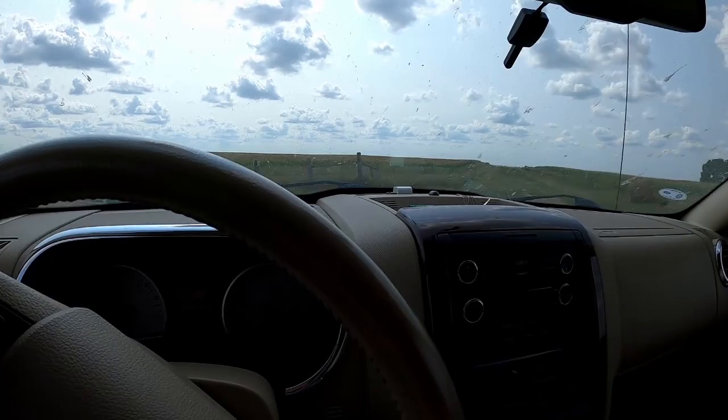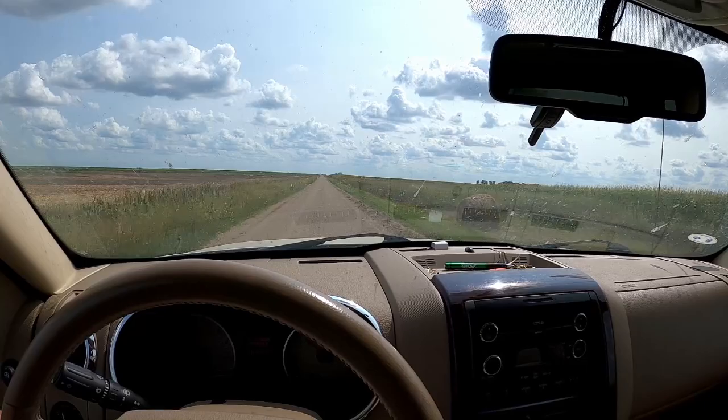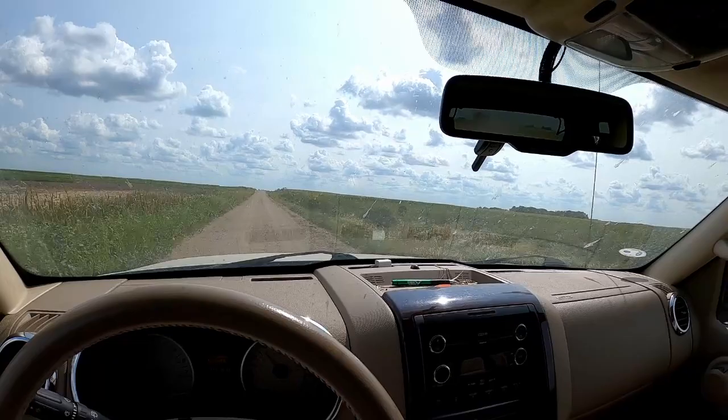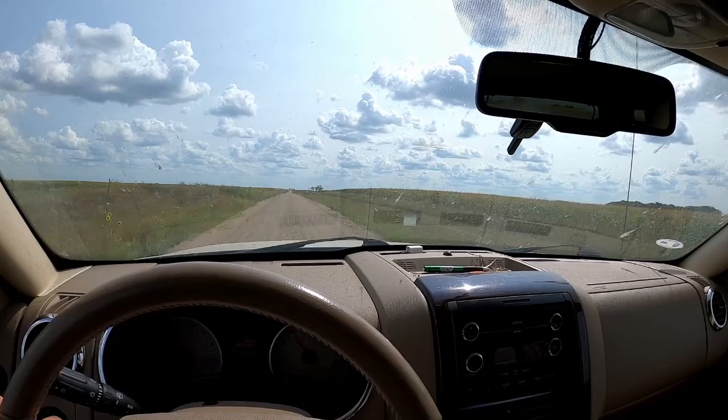So this is a 2010 Ford Explorer. And I can't remember, it's got that famous transmission that has those servo issues. I talked to the owner this morning and they said that it's kind of temperamental when it wants to be. These servos, the shafts and the bores tend to wear and cause slippage problems. So it's good to get it replaced anyways. See if we can get another shift here.